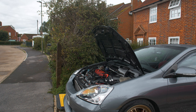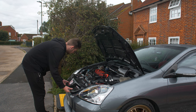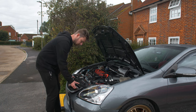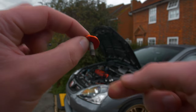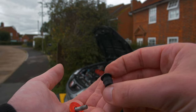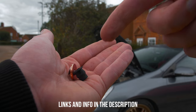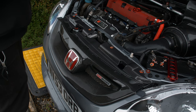This is the moment we've all been waiting for - let's install the grille back on. Even just dropping this in straight away shows you the difference - it looks crazy different. Before I fully install it, let me show you these red mounting pieces, because I get a load of questions about them. These replace the plastic clips that mount the grille to the front of the car. They have a thread inside so as you tighten them up they get squashed and become the washer that holds it from the back. I'll leave a link below - I've ordered a new set because these are getting tarnished.